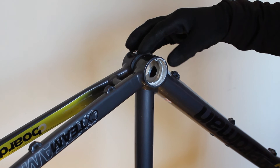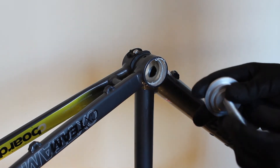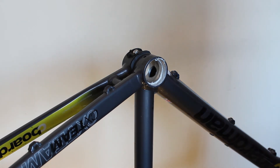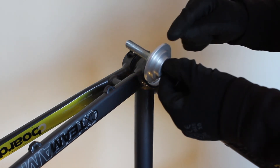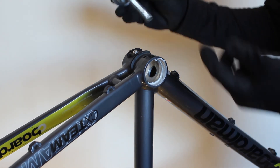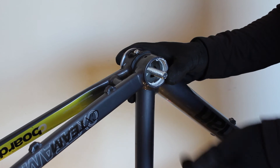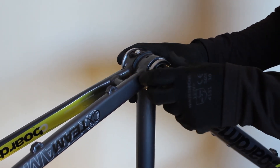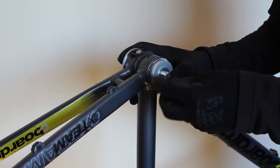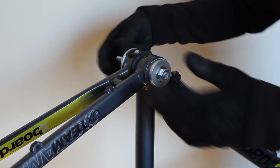If you're working with a brand new bike frame, or if you've chosen to remove both bearings already, then you've got an empty shell. The Burton Bikes BB tool is quite capable of pressing both bearings in at the same time, though some manufacturers recommend installing one bearing at a time. The Burton Bikes tool is unique in that it's got an extra lip on one of the press plates — there's a small disc and a large disc. The large disc enables you to insert the tool into an empty shell with no bearing already in. So this side of the shell is clean and empty, and the other side has grease already in it ready for a new bearing. Place the bearing cartridge in there, the small disc goes into it and up against it, and then there's a nut and a washer. Nip it up.